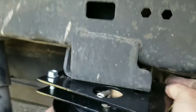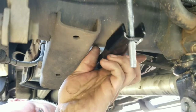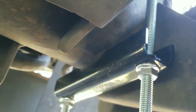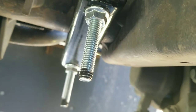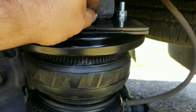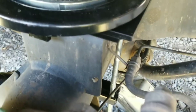As I start turning it, it should slip up into the groove it's supposed to be in. As far as the bottom side goes, you just flip it up and around the axle. This thing has a cup that fits the contour of the axle. The main thing on these is to tighten them down evenly — I just took my finger and measured them. That's pretty even and I just snugged them up, then went about another turn once they were snugged. I'll check the directions to see if they need to be torqued. The bag is installed; I went through and tightened these up. Both the bottom bolts are in — to the best of my knowledge that's how it's supposed to look. Now we'll move on to the other side.